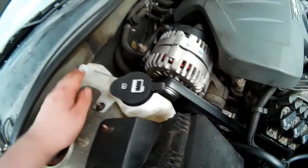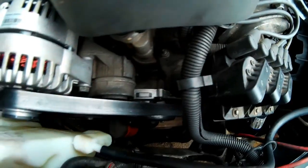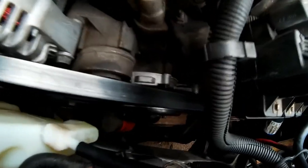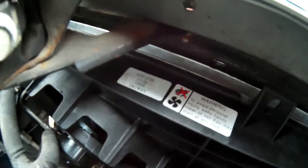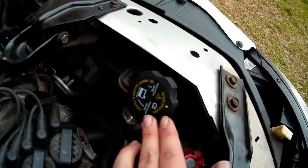I've gotten a brand new reservoir, a water pump, and a Felpro seal — metal on the outside, rubber on the inside. Because water is always flowing through it, the rubber seal should last a lot longer than the paper ones. Brand new lines all around, a brand new fan set — you can tell by the cute little stickers here — and a brand new radiator cap, which was $10.